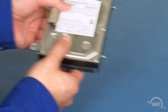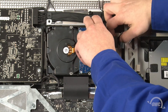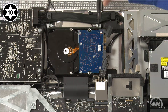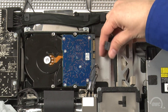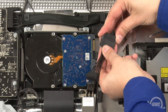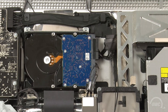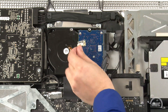There should be enough residual adhesive to allow it to stick. The drive is now ready to install into the iMac. Insert the two mounting pins into the two grommets in the iMac and lay the drive back into the bay, making sure that the SATA cables are out of the way. Replace the two Torx T10 screws that hold the drive in place. Attach the data cable directly to the new drive. Then, attach the OWC sensor cable into the power connector and the other end of the OWC cable into the hard drive. Position the cable in the channel to the right of the drive so that it sits out of the way. Finally, peel off the paper covering the adhesive backing on the sensor board and adhere the board to the drive near the spindle.